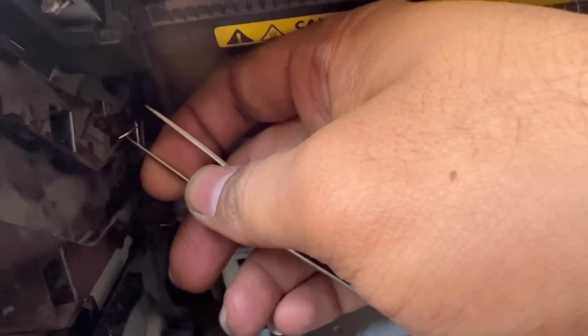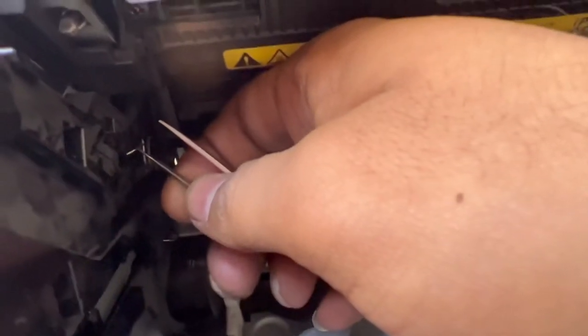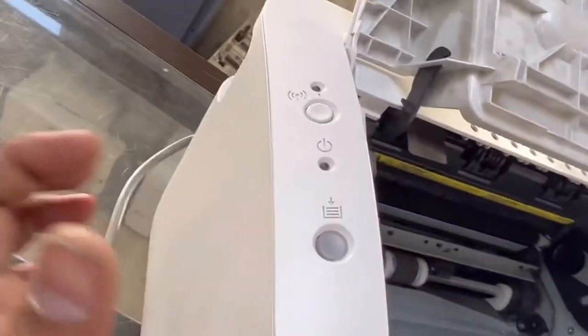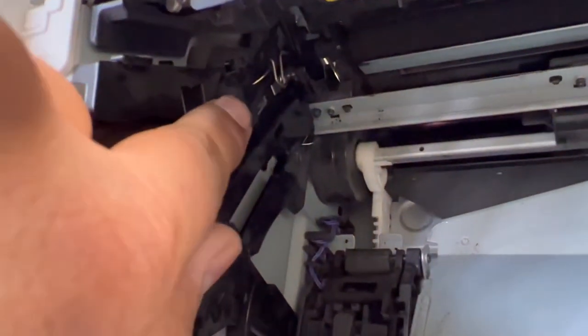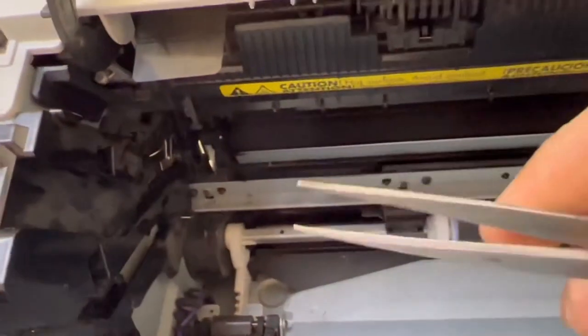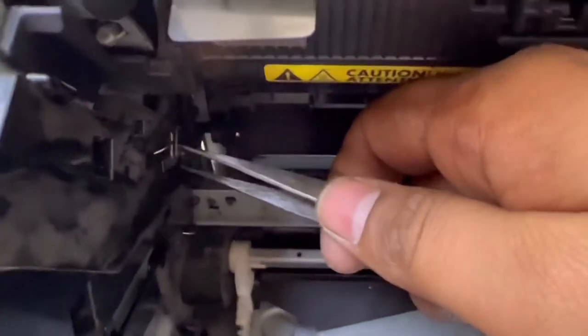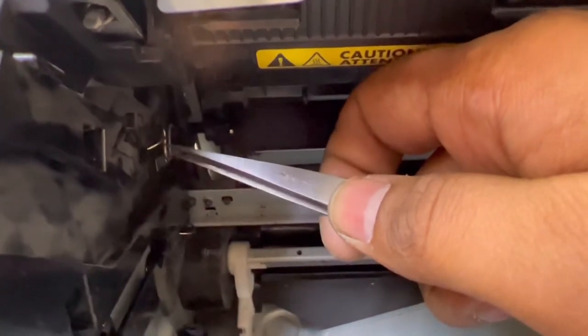Be careful — look, it came out. Be careful when you are pulling it outside: don't press it inside further. If it goes in too deep, you cannot pull it back without opening the main board. Look how smoothly I pulled it back out. If you use the wrong tools, the pressure may push this sensor inside strongly, and then you cannot pull it back with any kind of tool until you open the main board. You can see if we push it now with our hand it's coming out fine.